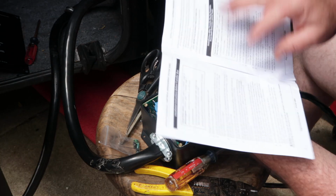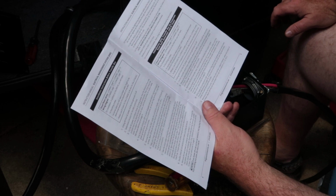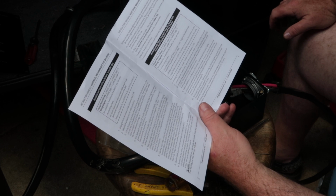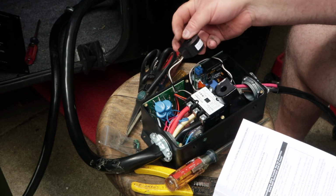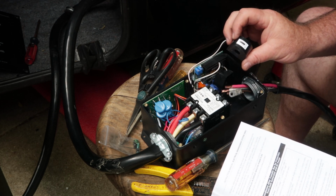So don't ever be ashamed to double, triple check yourself with these. The short cable coming from the junction box, but sliding it through the wire restraint, that's what I just did. Next, slide the black wire through the current sensor containing the green tape. So there should be one here with green tape. That's white. That's white with a black mark.